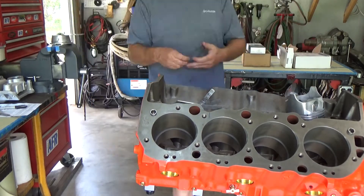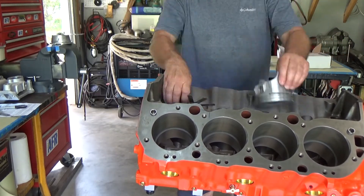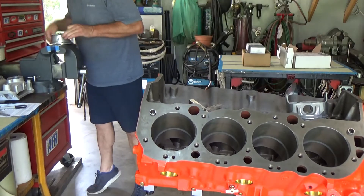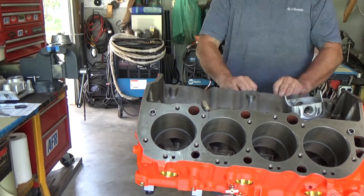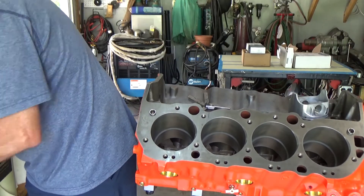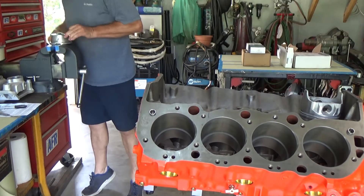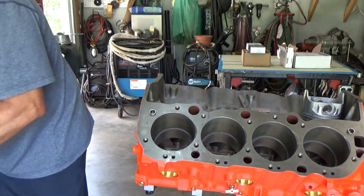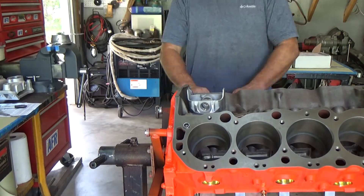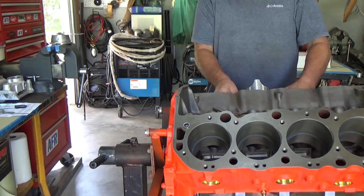The piston rings came with a Wiseco piston set I bought for the engine. The rings are advertised as JNE, which is a pretty good brand — they seem to have a moly inlay with a cast iron second ring. Also, with the ring filer, you'll notice I turn it into the ring counterclockwise. That's so the sharp edge won't protrude out, and also I wonder if turning it the other way could pull out that moly inlay from the top ring slot, so I always go counterclockwise when file fitting them.